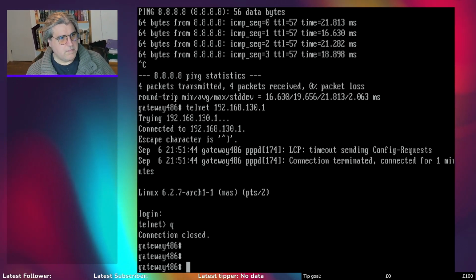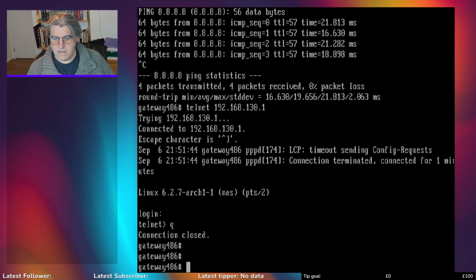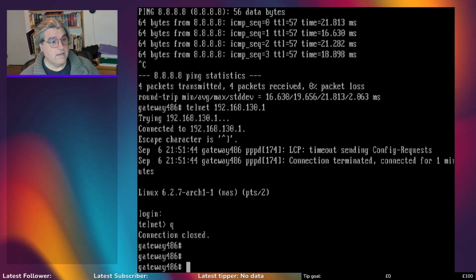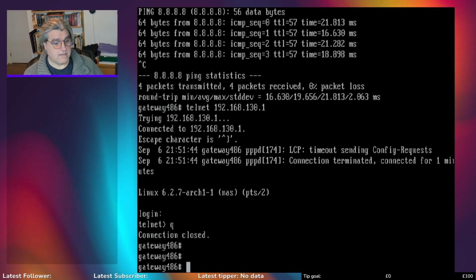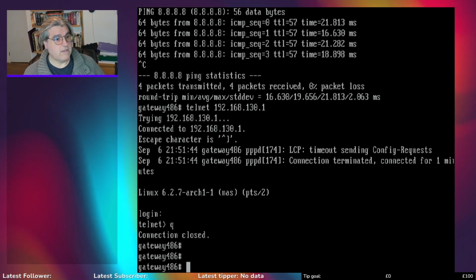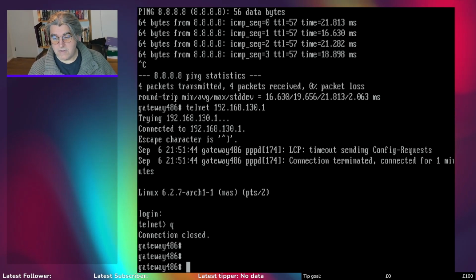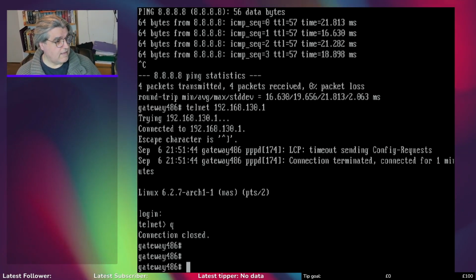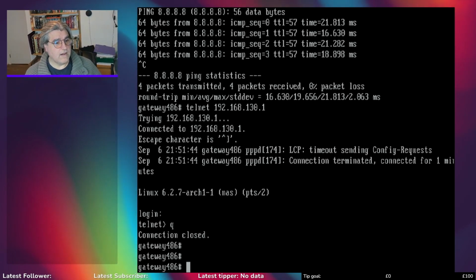I've still got this one to dump the memory from. I've got a little program that I've written for DOS that can do that for me. It actually dumps the entirety of the whole address space, or the conventional memory 1 meg address space into a file. So I can just dump the whole thing and then just probe through it and find the ROM without needing to know the address. So yeah, I'll do that later, I think, because it's now getting on towards 9 o'clock.